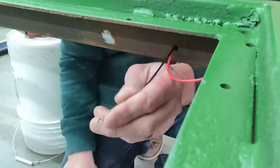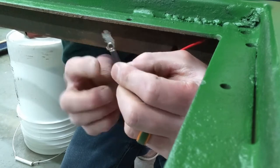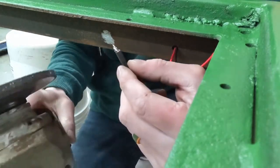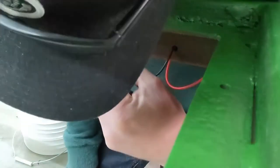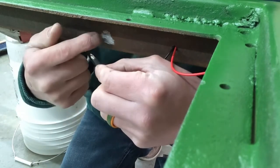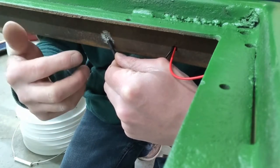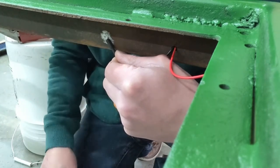Now we're going to go around and fasten all the ground wiring to the frame using a little self-tapping screw through the ring into the frame. Wherever you do that, make sure you get down to bare metal — use a wire brush or an angle grinder to lightly take off any paint or rust. Drive your screw, add a little dielectric grease to the connection, and after you can run some paint over it. You'll have a metal-to-metal connection that won't be covered with paint, so your ground will be good.